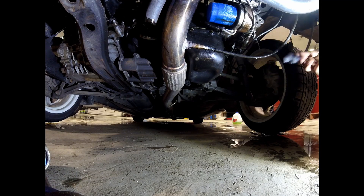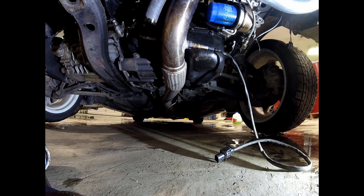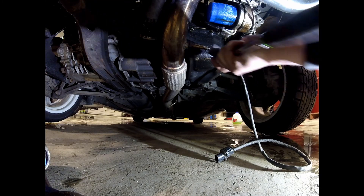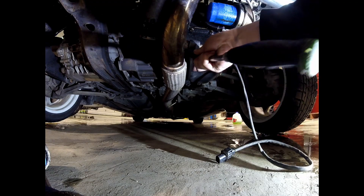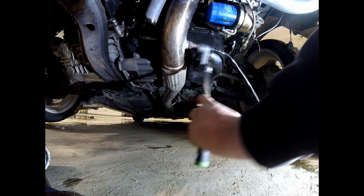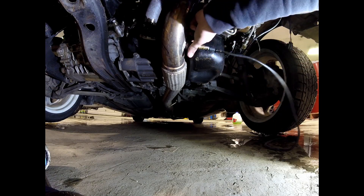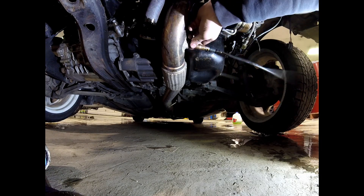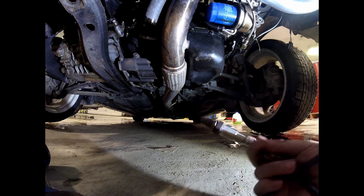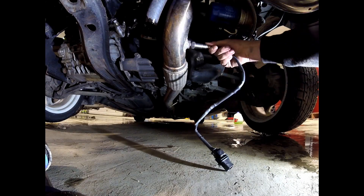So now I'm gonna jack it up and get that sensor off and put the new one in. I already got the other plug unplugged right here, I just kind of wrapped it up here to keep it out of the way of things. Pop that off and take this guy - let's see if I can bust this thing loose. I just took it off like two days ago so I could recalibrate it, just thought that I was gonna fix it. But nope, she's dead. And here's the new one. AEM actually puts a little bit of anti-seize on it for you, so that's kind of nice. Let's go ahead and get that thing started.